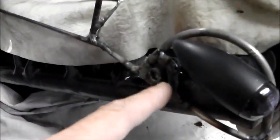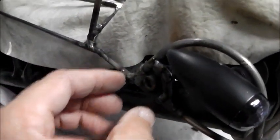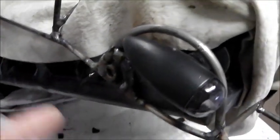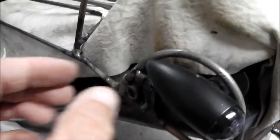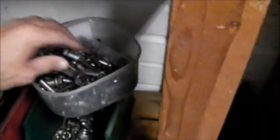Now, the idea of this is, boring, I know, but when that comes to bolt in, the fiberglass will come around that, leaving a hole. So effectively I'll be getting down to it. But what I'll use is a tube. Can't find them right now, but amongst this I've got some little metal tubes, and they'll go over the Allen head, even there, hand eye coordination. They'll go over the Allen head and just tack in gently, just a tiny tack to hold them, so that the mount bolts will go down inside a tube, which will look quite tidy.